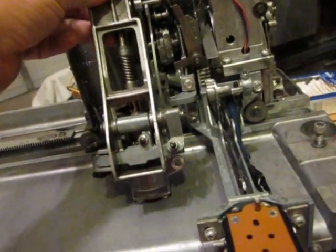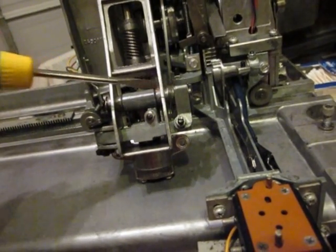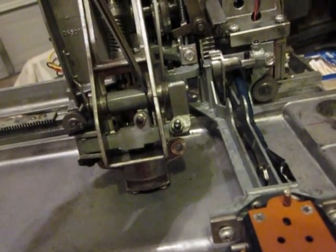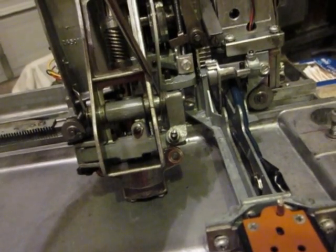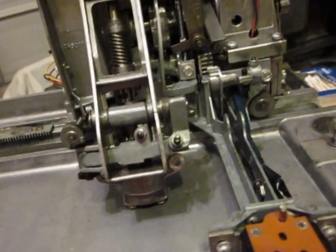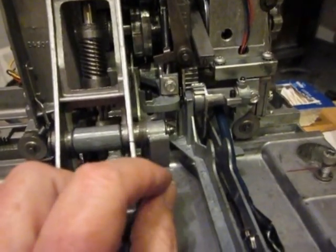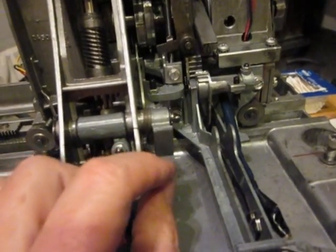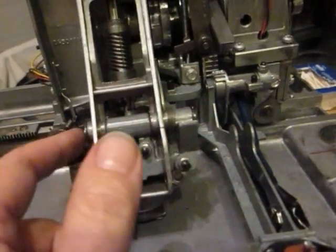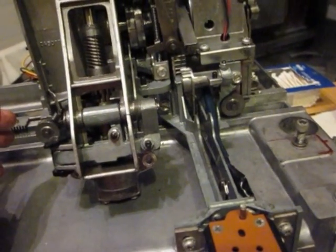You don't see that side normally — you see it like this. And you see this shaft right here, this little shaft in here. What happens a lot of times is that these points right inside here and here, and under that spring under there, those get all seized up with just old oil and gunk and don't work right. So this arm needs to be able to freely move like this. When I first was messing with this, it was not moving at all because it had so much junk in there. So it's very important to put oil in those spots to make this work, because if it doesn't, you're not going to have a jukebox that works correctly.